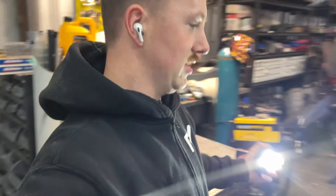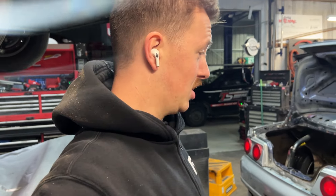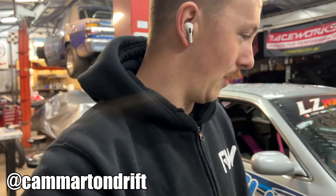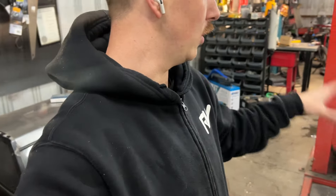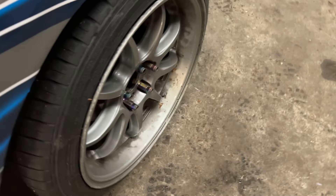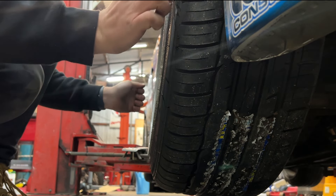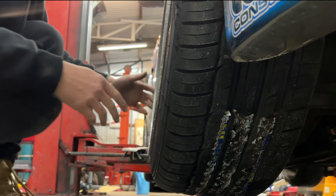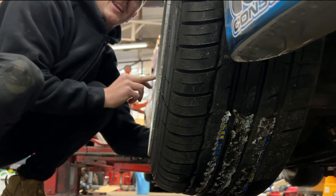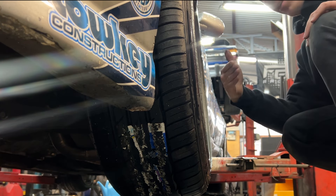Success. We're doing some maintenance on the R33 — we have the final round of the championship coming up next Saturday. If you don't follow me on Instagram, make sure you do — that's where I post a lot of my updates. Things we're doing: I need to buy new tie rods because they are both shot. When you turn your wheels sideways and jolt it, you want zero play — this thing actually has 10 to 15 mil of play in the tie rods which is your front steering, and the rear is basically the same.